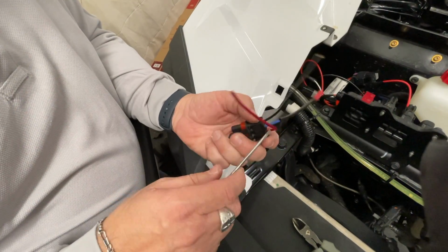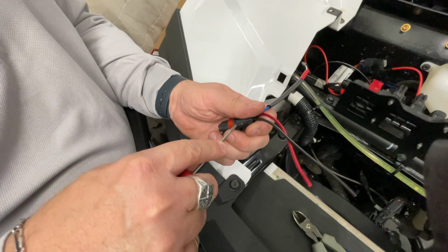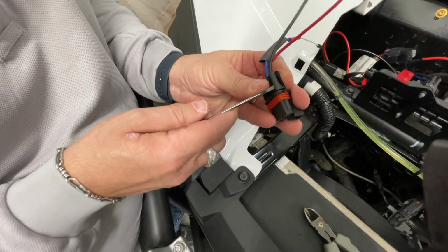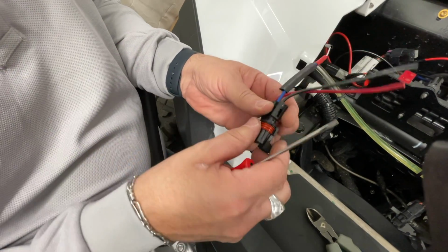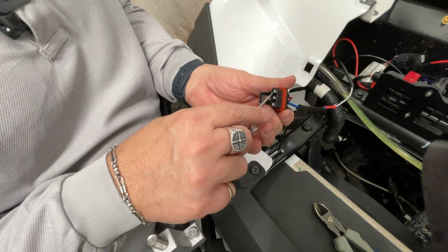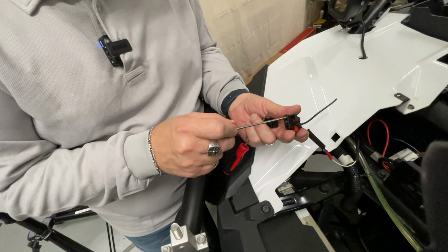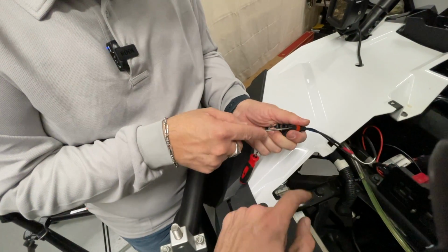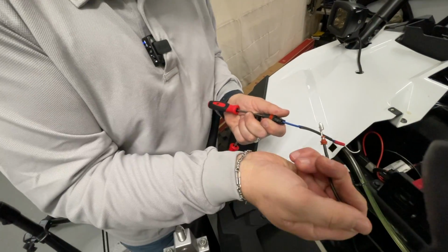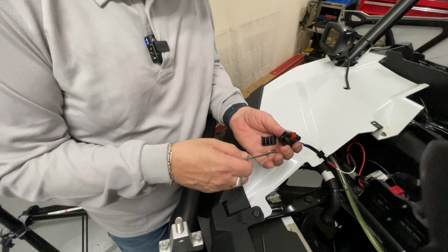So to take these extra wires out, you can just rip them out if you wanted to, but you risk damaging it. So what we're going to do is take off this little shield. And it takes a little bit of doing there. And this just slides right out. And then these wires now are captured. And I probably should use a pick. If you look here, that's the one we're taking out. Just a little pick. Just kind of shove it in. Make sure your hand's not in the way. And then pull it. Pops right out. It's kind of just captured in there with a little pin.